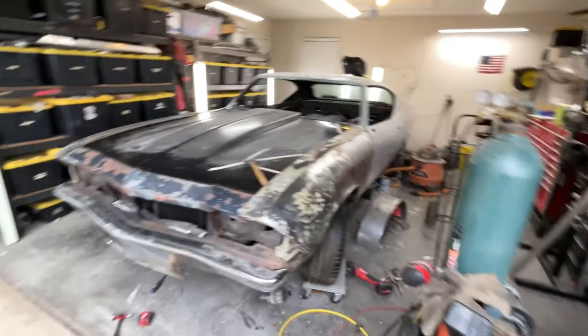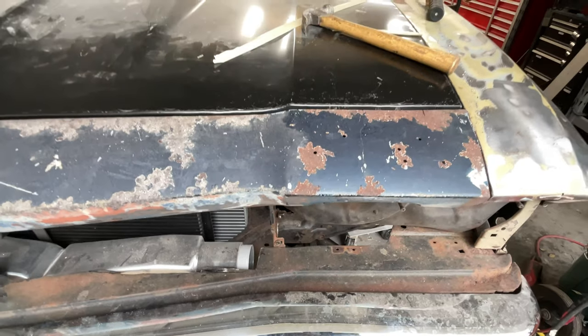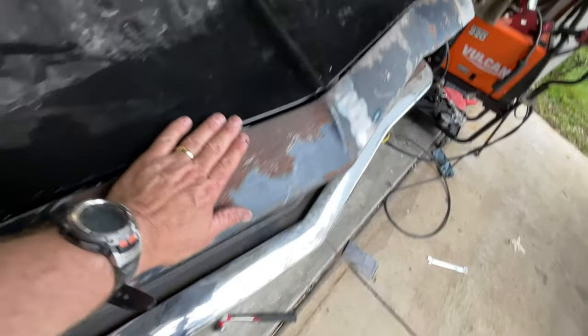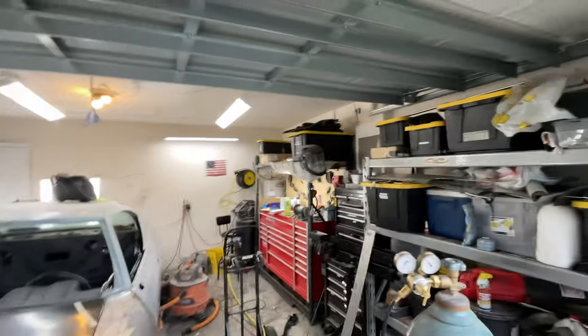Let's check it out. There we go - barely a difference now compared to what it was. The gaps on the hood are nice and tight. The gap down there is nice, so it's all nice and smooth. There's a little high spot there, but it's all within an eighth of an inch. You don't really want to do too much more than an eighth of an inch. Ideally it would be perfect, but I don't live in a perfect world - my cars don't either.